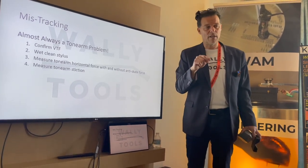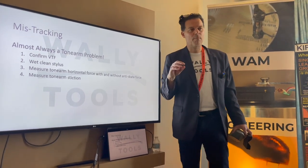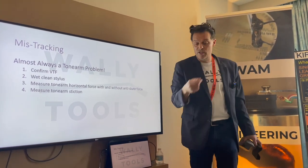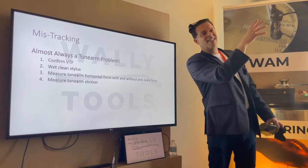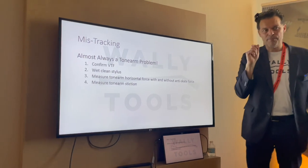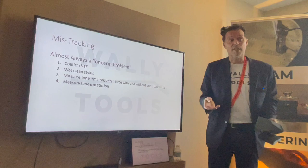You don't use a lot of liquid, because the dust on top of the cantilever will be a wonderful source of capillary action to bring the liquid right up the cantilever and carry the dust with it. You do that enough times, and that dust has found a new highway to get right back into the cartridge motor area and eventually seize it up. So be very, very conservative with the amount of water. But you can just use distilled water. Just do something. Why do I say that?